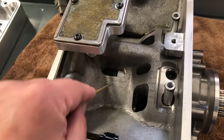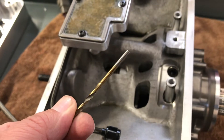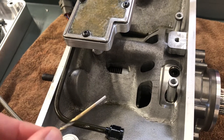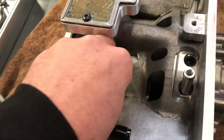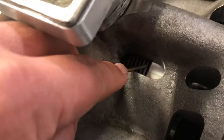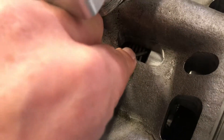Those slots will be up in the case when it's in the car, underneath the filter assembly. What I usually do is grab an eighth-inch drill bit, because the go/no-go spec on the clutch pack is 125 thousandths. You take the drill bit and sort of move the frictions and the steels apart.